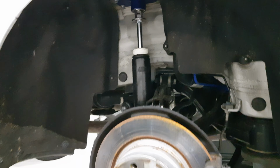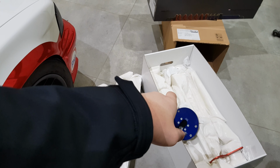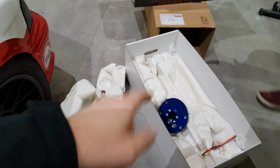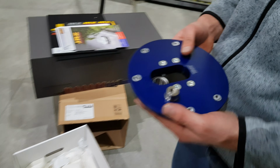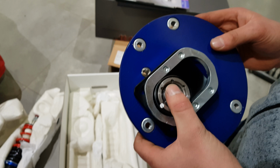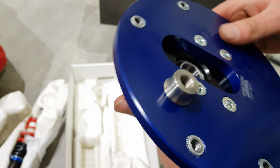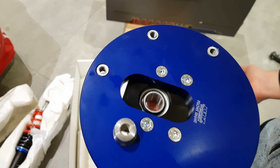Another comment, which we will see probably on the front but also on the rear: this is the JRZ RS1 Sport suspension. There is also a Touring version, and the difference is the camber plates. This is the front camber plate, and you can adjust the camber with it. You've got the rose jointed top mount, as you'd expect, with just camber adjustment left and right. Obviously there's no caster adjustment on this, but again, it's not something we really need to introduce to this car.